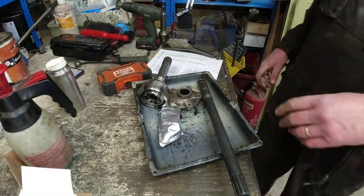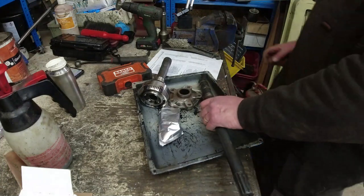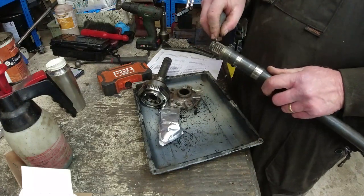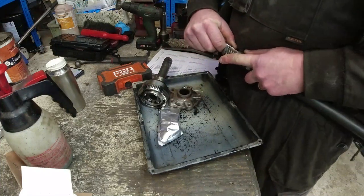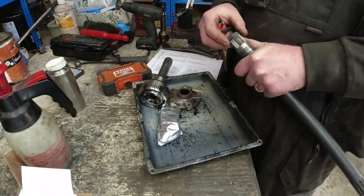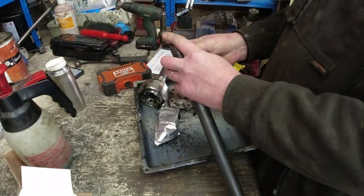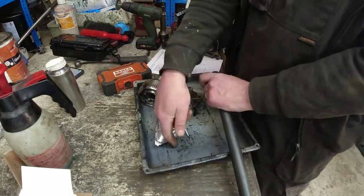It's just a straightforward assembly job — there's nothing particularly nasty about it. Make sure you've got the spacer. Make sure that your locking ring that holds the CV joint onto the drive shaft is in place. This one is shagged, so I'm going to take it off. These things come off usually fairly easily, but in this particular case this is going to fight me all the bloody way. I'll just prise it over the top. There's the old one.